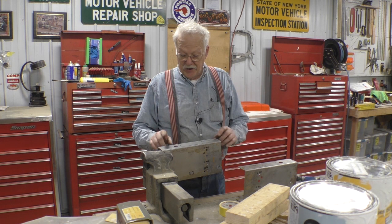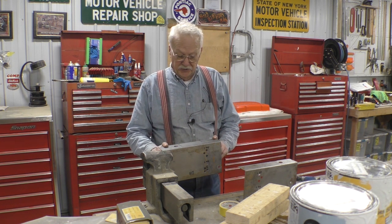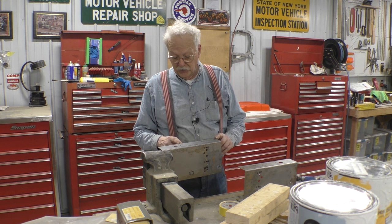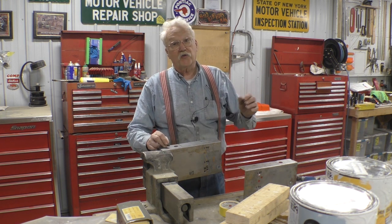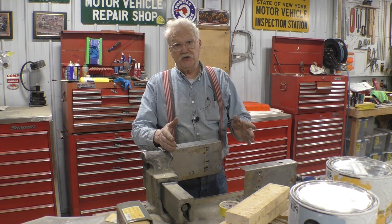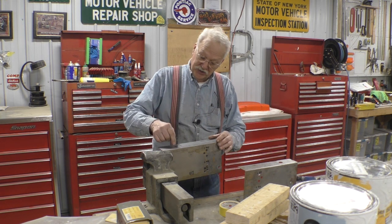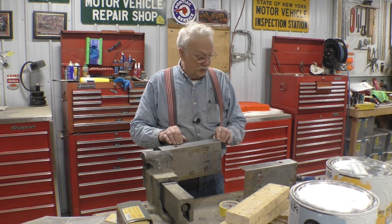The next step is to modify the template from the Brothers kit. We have to cut this notch out of the template and be careful not to over-cut, because this then becomes the gauge for how much frame we cut off in the back. Remember, we take 12 inches out of the center and six inches out of the back — this will be the gauge for six inches. It's also the gauge for the rear bumper hole. Let's cut this out carefully.